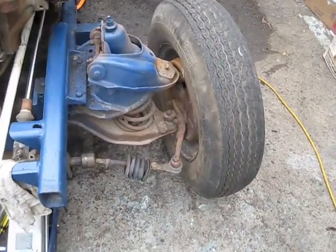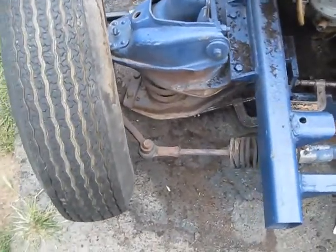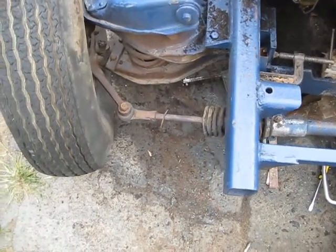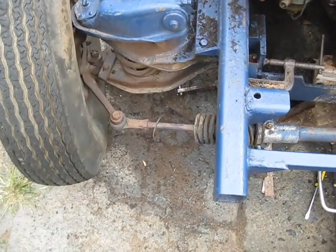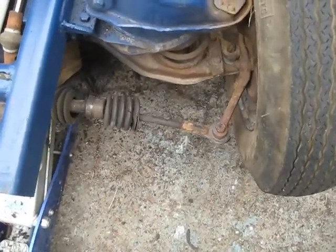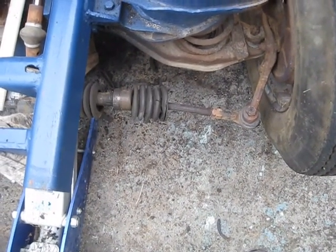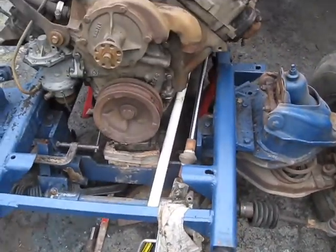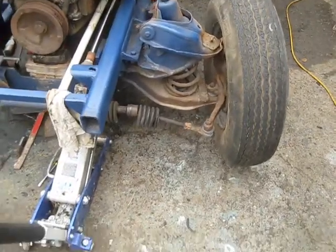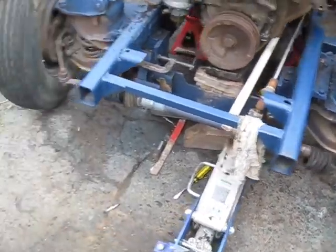Turned out I pulled the hubs apart — there's no sign of a break or anything in there. What I'm going to have to do is cut — I'll measure it, go lock to lock, make sure I got the right amount. But I think I need to cut about an inch out of this one and put about an inch in this one. Once I get all of this figured out exactly and I know it'll work, then I can make my brackets. I've got to let it down to where the wheels are compressed a little to make sure my tie rod ends are pretty straight.